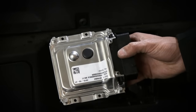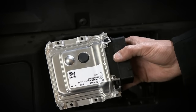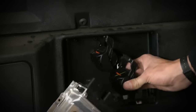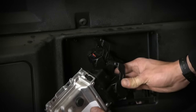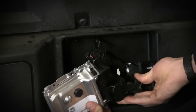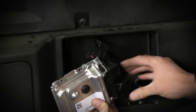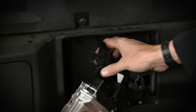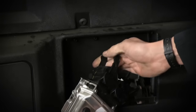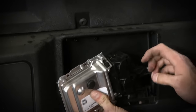Now it's time to grab your Super ATV Rev1 tuned ECU and install it back onto the machine. You'll do that by starting with the bottom plug, slide it onto the little notch starting with the bottom side, clip it on, make sure it's good and secure. Do the same with the top. It's as easy as that.